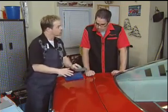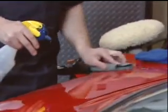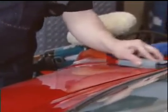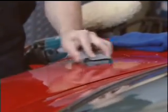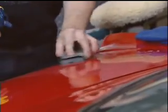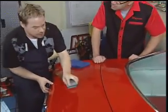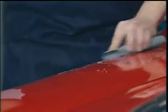That's the key, consistency. The first step is to spray the surface with a soapy water solution, which lubricates the surface to prevent any scratches. Then Kevin uses the fine sanding pad to lightly scuff the top layer of paint, which is actually the clear coat finish on our particular car. And although it looks like I'm covering a lot of ground fast, I'm really using a soft touch. It is important to respray the surface with water to lubricate it and prevent a dry, rough sand.